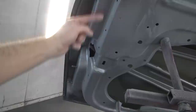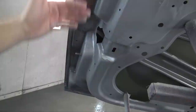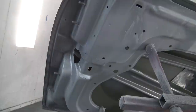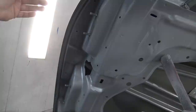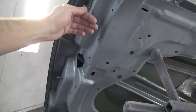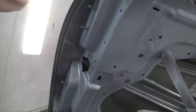What I'm going to do is paint this, wrap it around to about here, then when I paint the back side where the door panel goes, I'll just scuff this and bring the clear up to that spot. I'll back mask it and it'll look perfectly fine. A good tip for doing the front before the back: if I painted the back part first and wrapped the clear over it, since I'm going to clear bra it, if they peel the clear bra on that edge it could lift that clear up. Doing it this way, the clear is coming this direction, so when you're peeling this way it's not going to lift the clear.